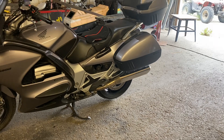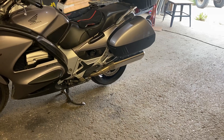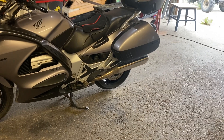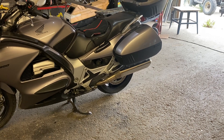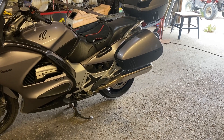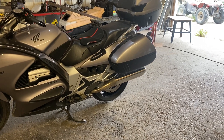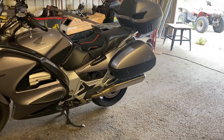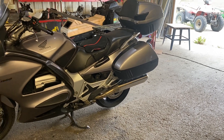I also haven't ruled out that it could actually be completely normal. Maybe some other ST 1300 owners — or even ST 1100 owners — could try theirs like this and see if it makes a similar noise. With the bike off the ground, the suspension is fully extended, so the U-joint is running at a greater angle than it normally does. Also, these ST 1300s are noted to have a fair bit of backlash in the drive system, so it could be a problem that appears when not under load and goes away under load.